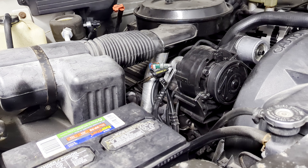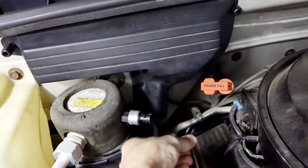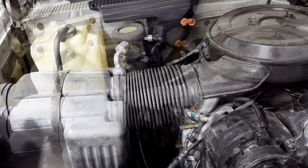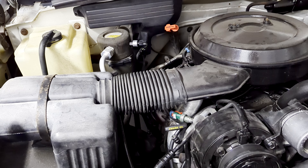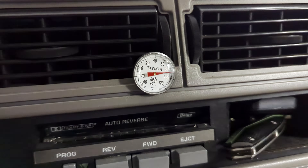It took me maybe a couple of minutes to do that. For the low pressure switch it's the same thing — pull the connector off, spin it off with a 5/8 wrench, put the new one on, and put your connector back on. I'll link both the low pressure switch ($12) and high pressure switch in the description. With the new switch in, I turn the truck on and test it — we're at 85 degrees right now and we'll see if we get any cooler with the new high pressure switch.